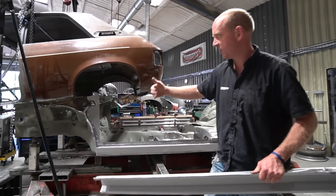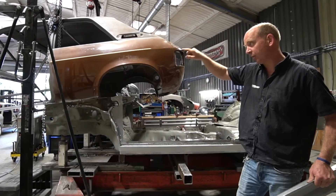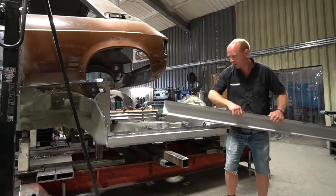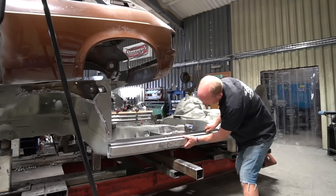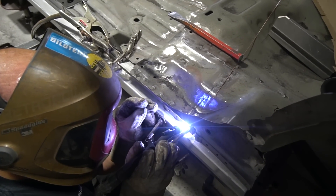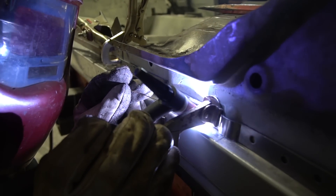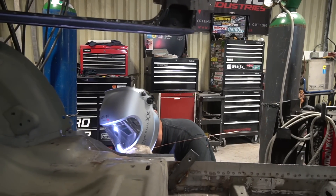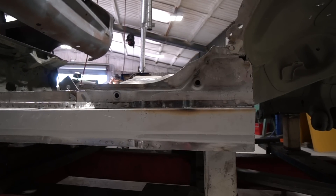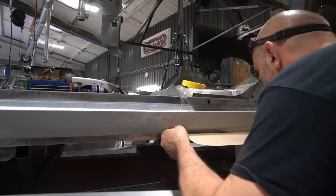The flanges will be abraded before spot welding and sprayed with a zinc-rich weld-through primer. The joint is basically in line with the door shut point. The outer sills spot-weld into the Allegro half of the body shell and then spread to go over the inner sections. The structure is all quite heavy duty - the Integra was originally well reinforced in the sill area while the Allegro was hopelessly weak, so we've added a lot of beam strength to keep the car as strong as possible - stronger than a standard Allegro would have been.